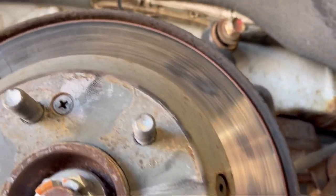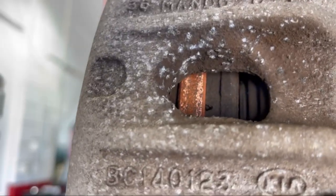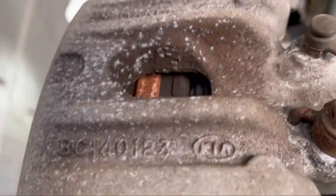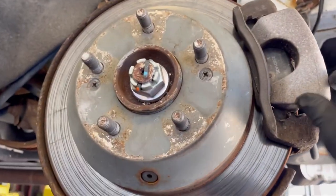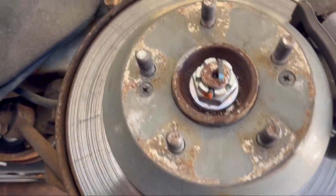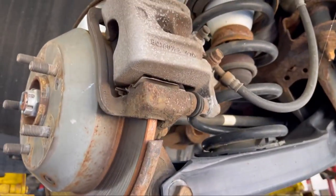As you can see, the rotor has hotspots right there, so the problem is caused by the brake hose and possibly the brake caliper. When you compare to the left side, the inner pad and outer pad have similar wear — the wear patterns are the same — and the outside rotor doesn't have any hotspots.